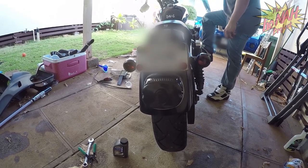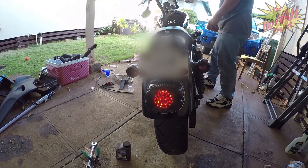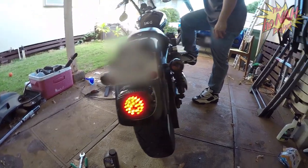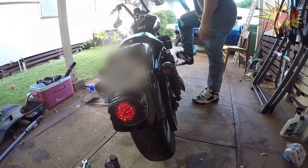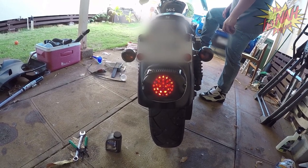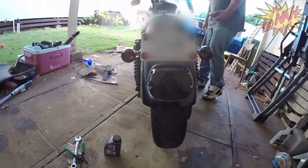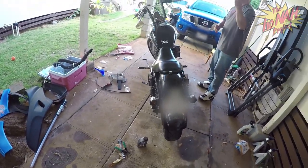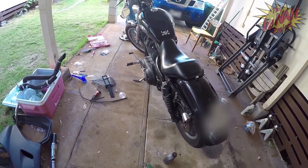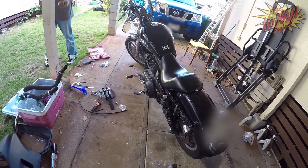So the handbrake works good, but the rear pedal - I'm kicking it and nothing happens. That's basically because either the brake light switch is busted or the wire connecting to it is no good. We're gonna switch that out today and show you guys step by step on this model, and then maybe we'll do one on a GSXR so everybody can see how that's done.